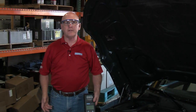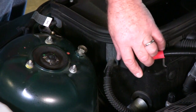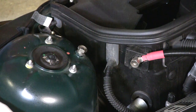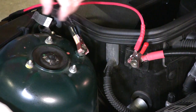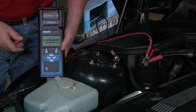A lot of the modern vehicles we're seeing today, they've actually hidden the battery. In this case, a manufacturer provided some really good jumper posts under hood. They may be fine for jump starting, but let's see if they're still effective when we try to do a battery test from this position. I'll take the cover off this positive terminal and connect the positive lead — nice, sturdy bolt head there. And there's another connection they provided for the negative side. The tester turns on and we'll go ahead and start walking through the menu.